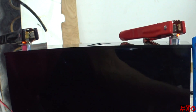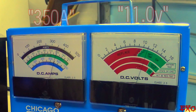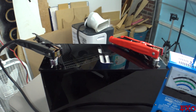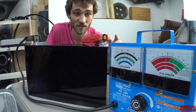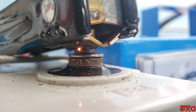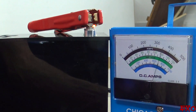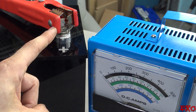Check that out — our terminals are getting red hot! Red hot terminals over there. Let's turn that down. We got smoke coming off of our terminals — they were just smoking up pretty good. And since we just witnessed that, it's a great time to stress how important your connections are. I guarantee if there was a nice secure bolt-on connection here, heat would not be nearly as high. All of that amperage is only being delivered to the very tip of those alligator clips, which only make contact in very few places — no wonder we're burning up the ends of them. Loose connections are the devil of car audio.